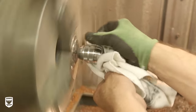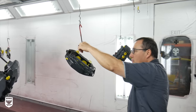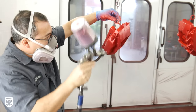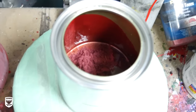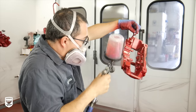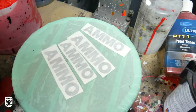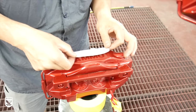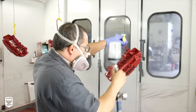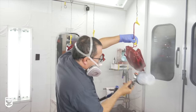The damage is gone and it looked much better than before. Over in the paint booth, Greg was double checking the cleanliness of the calipers and preparing for the first few light base coats. Next, the pearl is mixed in with the color for its unique and brilliant mid-coat layer. Once coat number two was dried and before the third and final coat, Greg applies the Ammo logos to all four caliper faces where the original R8 logo once was. Afterwards, the last layer of high-temp clear is applied and allowed to bake overnight.